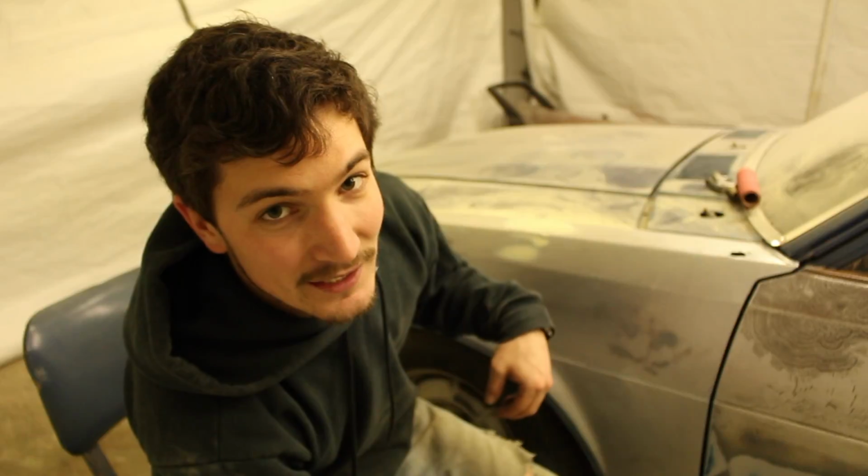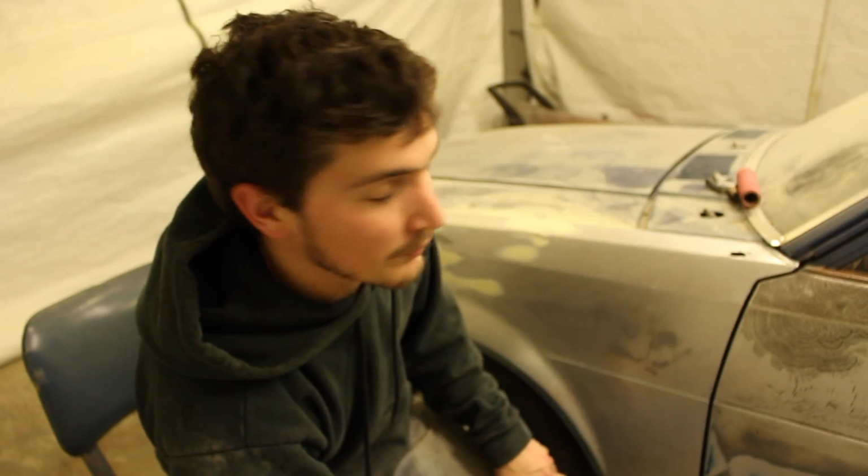But normally don't do that if you're just doing some standard blending onto another panel. That's a no-no, because you'll have to put paint on that edge and do some crazy taping on the inside, which is really difficult. So normally you wouldn't scuff your edges.